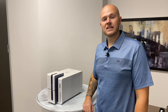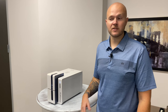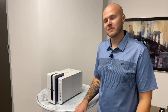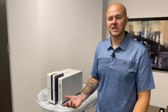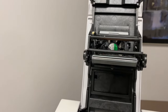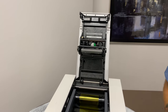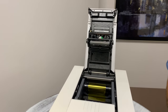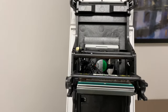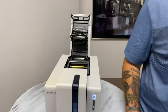If you ever get white lines or a single white line on your card that you just can't seem to get rid of, it's a pretty common thing, especially with older ID badge printers. Customers usually first try cleaning the printer to get rid of that white line, but I'm going to show you what the issue is — it's not actually a cleaning issue. What that is is your printhead, which is located right here on the Evolis Primacy. It means your printhead has been scratched or damaged — a pixel has been fried, in a sense — and there's no way to clean it. The only way to get rid of those white lines on your card is to actually replace the entire printhead. Contact Newart — we carry these printheads in stock and we'll be happy to help you out with getting that printhead and walking you through how to replace it.